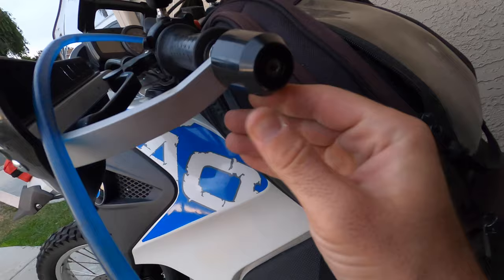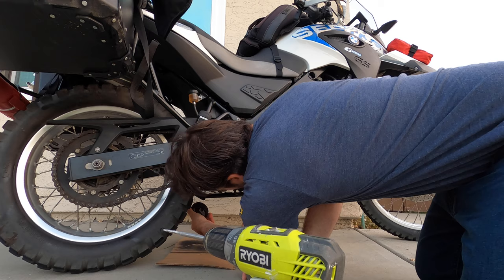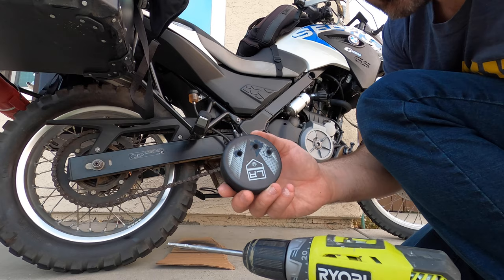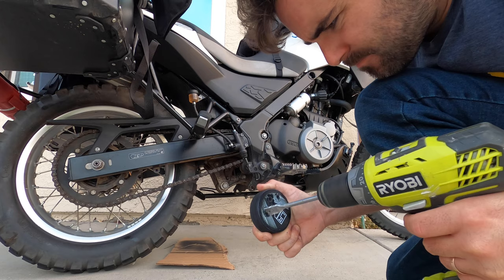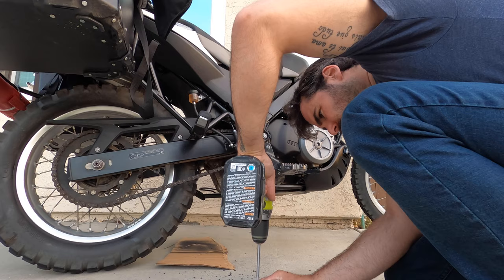Use a 5/8 drill bit to create the three holes on the bottom of the puck about midway. This size drill offers you the ability to recess the nut into the puck, thus giving you a smooth, grippy surface. This is a wood drill bit and it has no trouble at all drilling into the puck. This size also allows you to place a socket around the bolt when tightening it later. Drill just far enough to hide the nut in completely, about halfway.